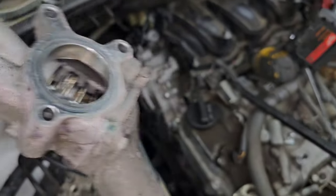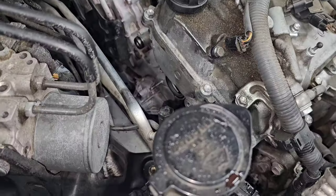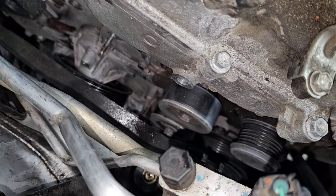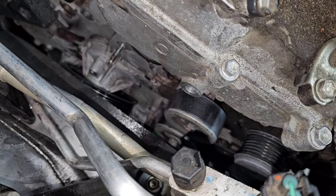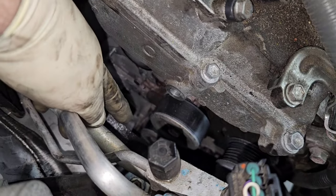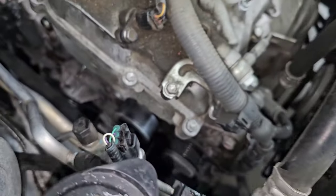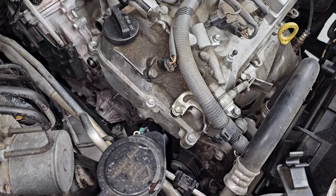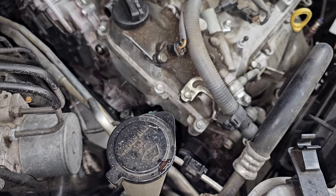We should probably be getting a thermostat for this thing too, considering I haven't gotten any coolant out of this motor yet — I don't like that. With that out of the way, I'm going to have to take that idler pulley out of the way. I do have a new one. We're going to take the idler pulley out because there's a bolt hidden behind it, and we've got to get the tensioner off too — the tensioner is sandwiched between the AC compressor and the block. But it should just be a matter of unbolting the compressor and moving it out of the way. I don't think I have to draw down the AC system or anything like that.